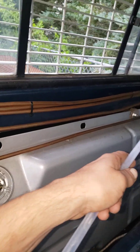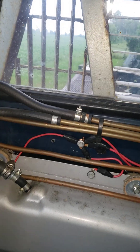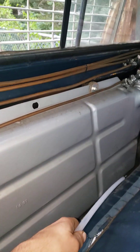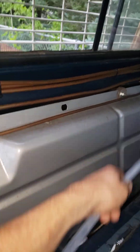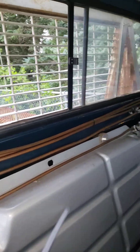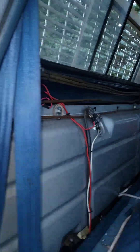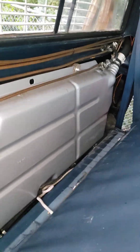That's the main thing — you have to not only have lines going through the floor, but from one side of the tank to the other side of the tank. That's important. If you roll on your driver's door and I just had it going through the floor here, it's going to go right on my exhaust. It'll dump right down there — and guess what happens then. So you have to go from this side of the tank to that side of the tank.